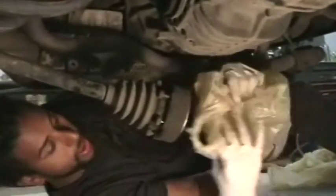Once you get it loose, and you get all the axle bolts out and down, pull the CV out of the way, go into your kitchen, get a plastic bag, put it around the CV joint to keep it clean. 2 bags will do fine, and then tape it up tight with some regular masking tape.